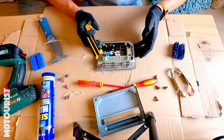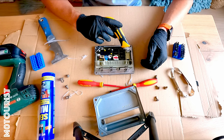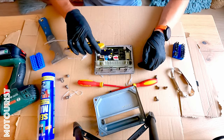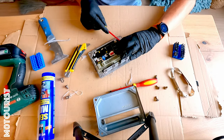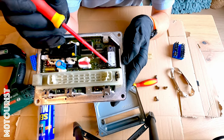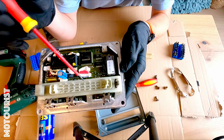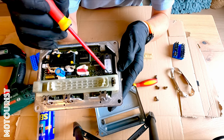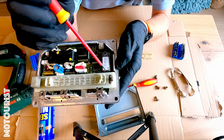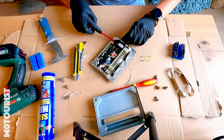That's clean as well. Looking at the ECU, this is actually the chip that I'm going to replace, so I've got to wiggle that off quite carefully. If you look at the chip, there's a small notch on one side near all the connectors that go to the rest of the bike. The replacement chip also has this, so I need to make sure that it ends up in the same place.